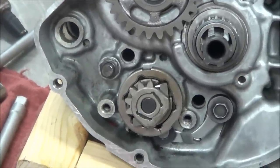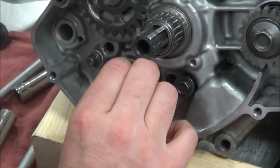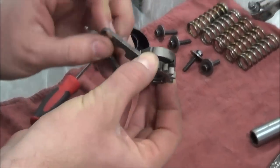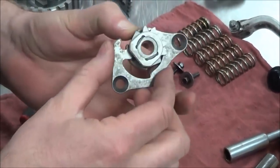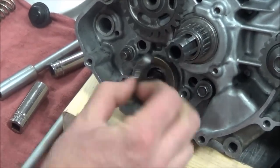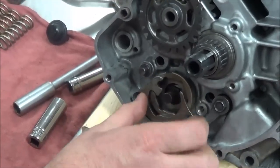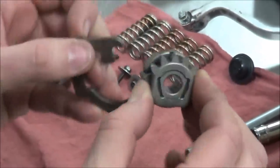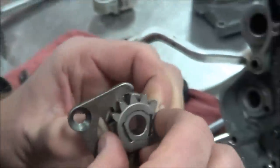When it gets to its resting place it snaps back out — one is rolling into itself, the other is grabbing the drum. Here's where it gets cumbersome: this plate. If you guys remember, this only has one way it likes to fit on here. The manual doesn't give you an exact position, but I keep protecting the springs — I don't want those to drop. I'm looking to set this on and get it in place. See how this way it can't sit on there — my holes won't line up. I need to land like this so I can engage into that shift. Coming from underneath, I'm going to find that sweet spot — there we go.